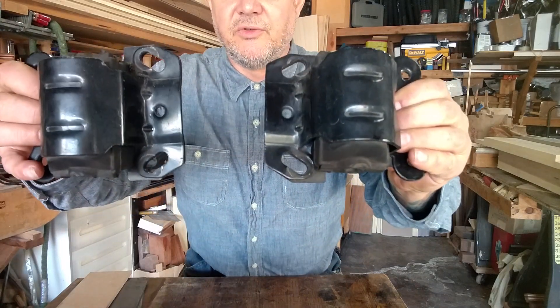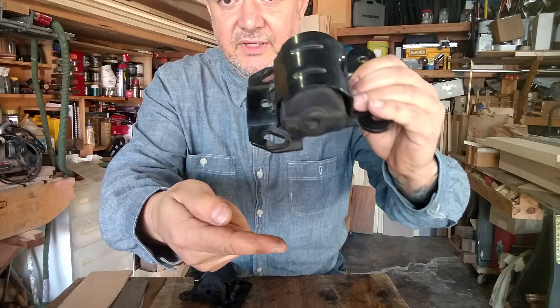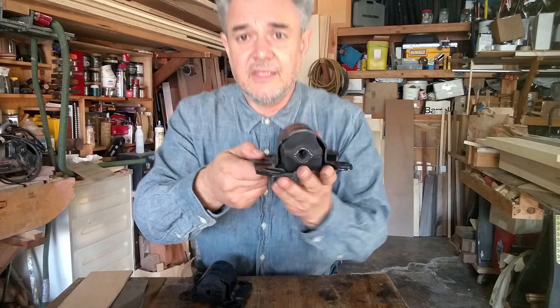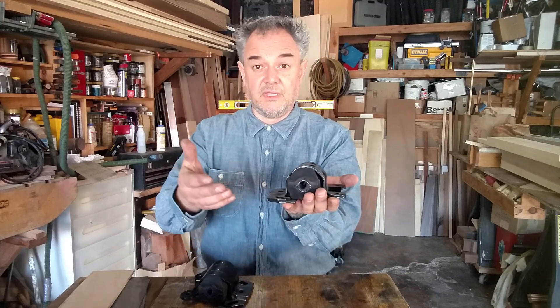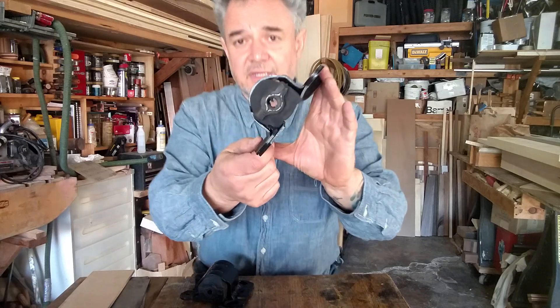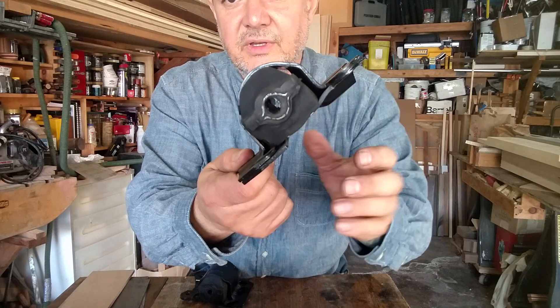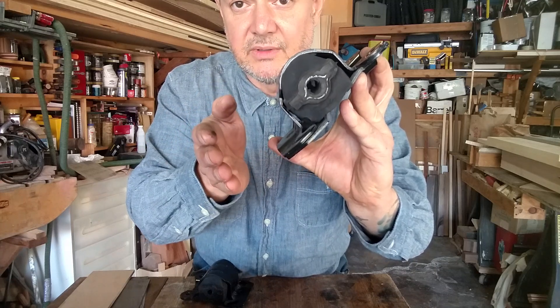I found my original mounts — thank God they were original. This is the passenger side and this is the driver's side. If you look at those bushings inside the cage, you'll see that the bushing is slid back towards the rear of the vehicle about a quarter of an inch. These mounts aren't mounted flat — they're mounted on an angle inside the vehicle. You can see there's space on one side but no space on the other; the bushing has deteriorated over time and the weight of the motor has pulled it down towards that part of the cage. That's what lowered the motor on that side.